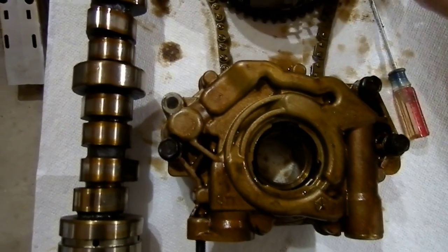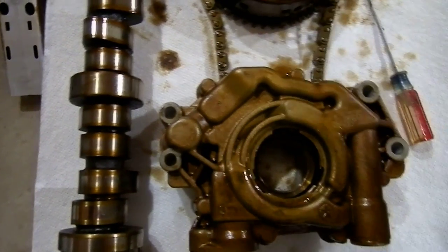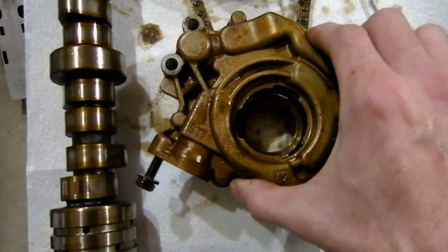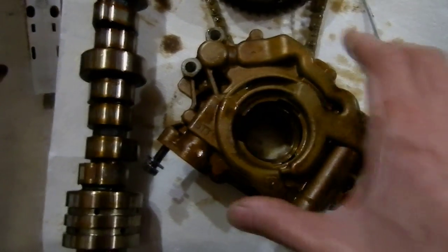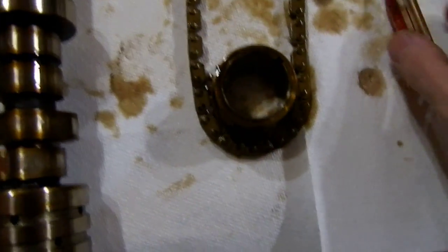What you do is pull out these four bolts, and this oil pump actually rotates like this while in the car. You can unbolt the pickup here and just let it sit in the oil pan. This comes off, and you've got your lower gear here. There's also one mark down at the bottom — it's hard to see — and a corresponding mark on the camshaft gear.